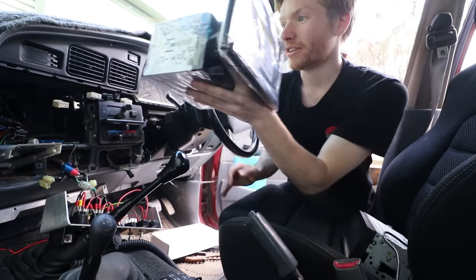Everything's in. We're back in the car and I'm ready to show you what it's all like, what it does, how much it costs, and what these switches do. The panel's back in, all painted now — just cheap Bunnings paint, flat black, but it comes up a treat. I added that voltage meter, which is measuring the second battery voltage and has a little display showing how full it is — not entirely accurate since it's going off voltage, but a good quick visualiser. We've still got our USB ports, cigarette sockets, and the UHF plug-in spot. It looks really neat.